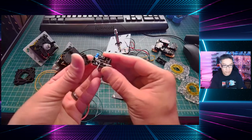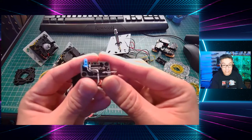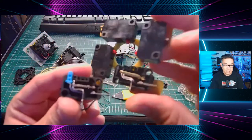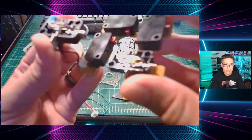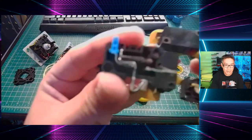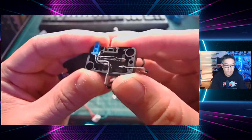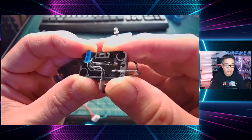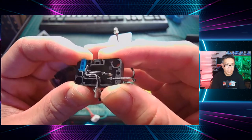But here is the blue micro switch. And look, it's getting a little bit better. This is getting closer to that Sanwa design that we saw there, right? So this is the Sanwa, and you see kind of that metal brass point there. Let's see if we can focus in a little bit. All right, so this is that new micro switch there. The blue one, when you press it down, is still using a spring tension to be able to press down far enough to flip it down and touch the connection points.